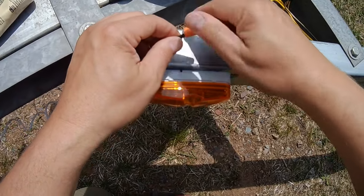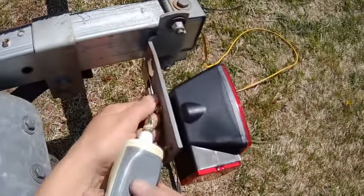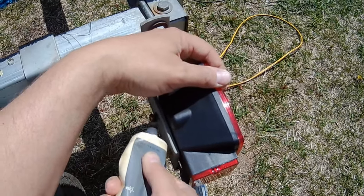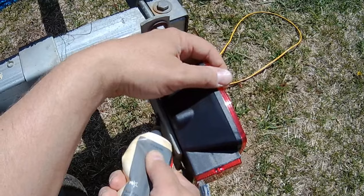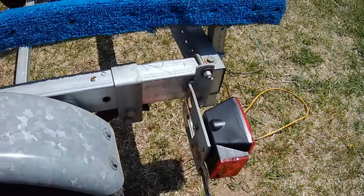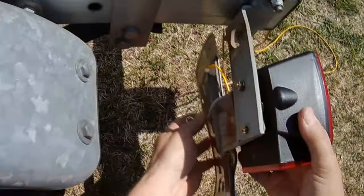Now, on these tail lights, I need to do something with this white wire that comes out of the fixture, right? I need to ground that to the trailer frame. And remember, I'm pretty confident that this bolted-on bracket is going to provide a good electrical connection to the main frame of the trailer. So I'm going to ground this white wire by putting it right on the mounting stud